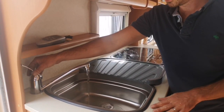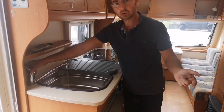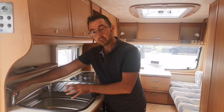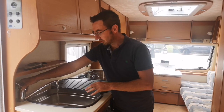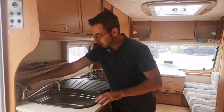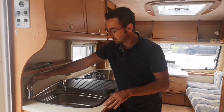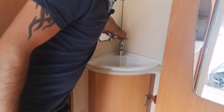To fill the hot water tank, we literally just turn the tap to the hot side. That's going to draw the water through the Truma water heater and fill it up - you may get a bit of coughing and spluttering and a little bit of air in the system for the first three to five minutes. Once we get a nice constant flow of water, we know that the water tank is pretty much full. I'll do the cold system as well because it's a pressurised system and we need to get water through all taps just to make sure we've got no pressure loss in any of the pipework. Once you've turned the tap off, the water pump will run for about 30 seconds and then cut off.